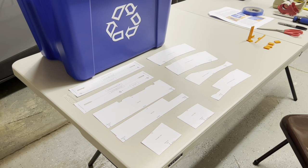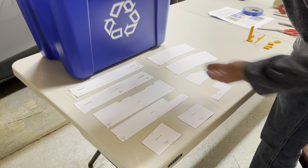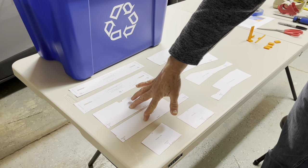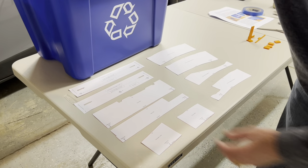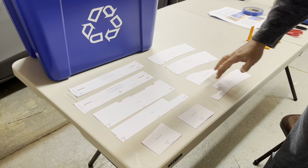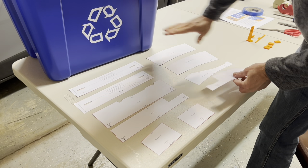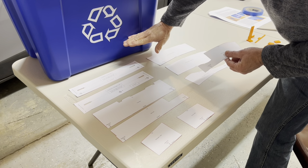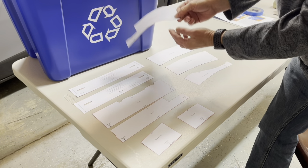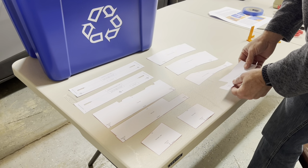Here's what we have after all the cutting: we'll have these two pieces for drilling the holes on the bottom, these are the front and back pieces, one for each side, and here are the four corner pieces. The idea is that we won't be putting a baseline on the bin directly. These corner pieces — even though they look curved — will straighten out once we apply them to the bin.